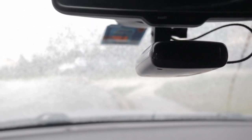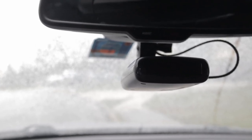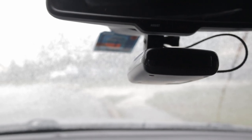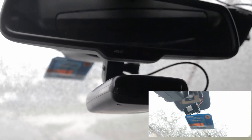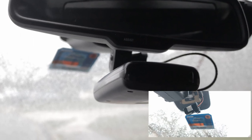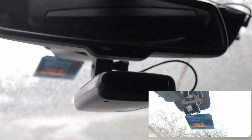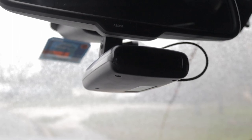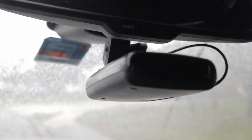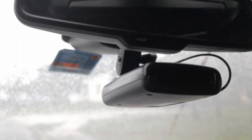Once you have that housing taken off, the next thing you want to do is pull out the wiring harness that's in the back of the mirror that actually powers your mirror. As you can see in this picture, it has a pretty basic setup. This is a V6 Charger. The V8 Chargers will have more wires — I don't own a V8 Charger so I don't know what the extra wires are for — but once you pull that harness out, you're ready for the next step.